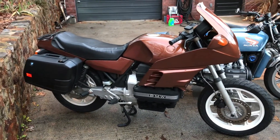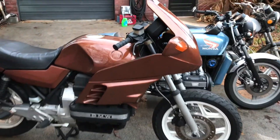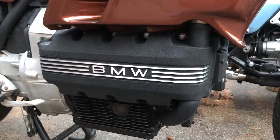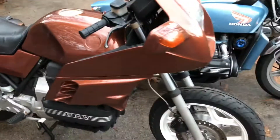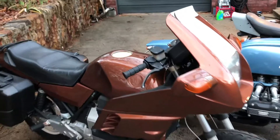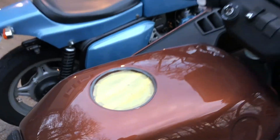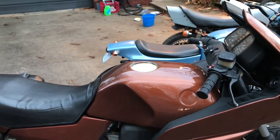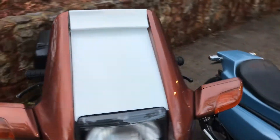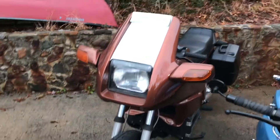I took it all down, cleaned up the frame where it was damaged and rusty, cleaned up all the controls, cleaned up the motor, and lubed the splines. One part I'm particularly proud of are the cases — they've got a real nice wrinkle black finish. I did that with VHT wrinkle black paint and I think it turned out really, really well. I've got a slight issue with some fuel venting around the seam there that I'm addressing, hopefully taken care of this evening. But yeah, it runs — ridden it around town a little bit — a couple of loose ends to tie up, but that's kind of a long distance bike.